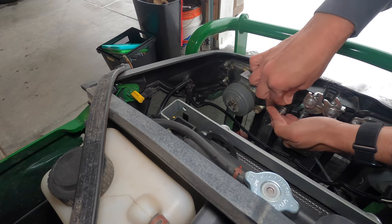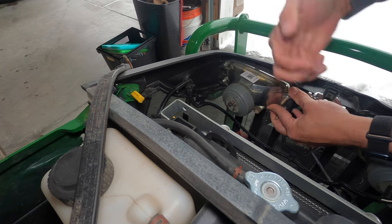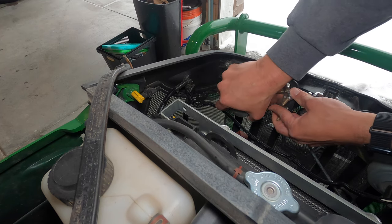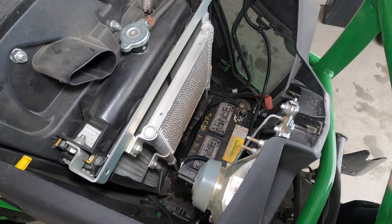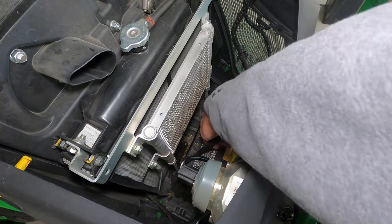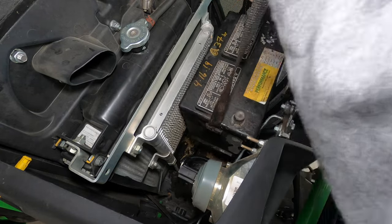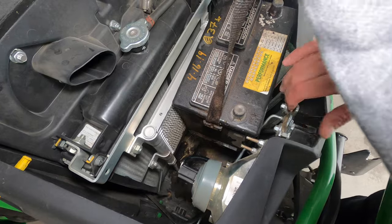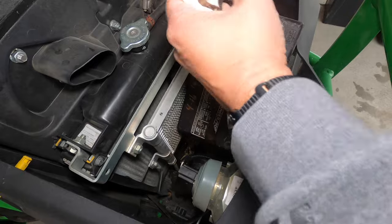After you've got those studs loosened and removed, we're basically going to angle this side out and pull the headlight this way — just like that. Now that the headlight's out of the way, we're going to grab the strap from the battery and just pull it up. I'm going to bring it over here. Now it is a tight fit, no doubt.